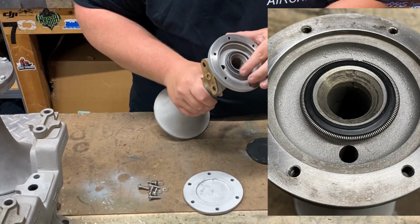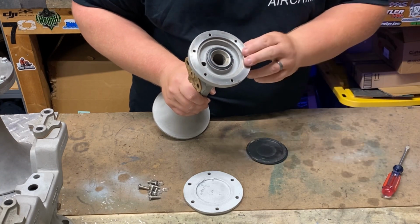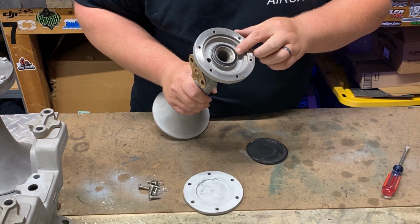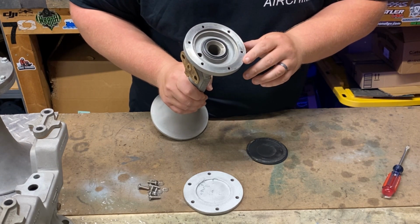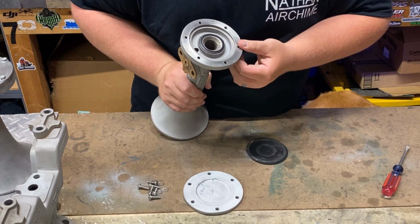Anyway, so on the inside, your nozzle or your seat on a P-horn is rubber. It's a rubber seat, rubber nozzle. Some people call it a nozzle, some call it a seat. I think the proper term is a seat. You also have a retainer spring that holds a nozzle on. These nozzles are pretty tough. I've only ever had to replace a couple, and I've had a lot of P-horns, but you can get them fairly easy.